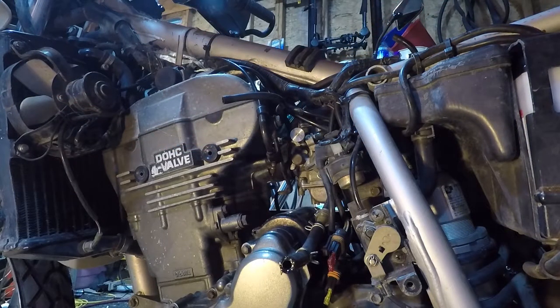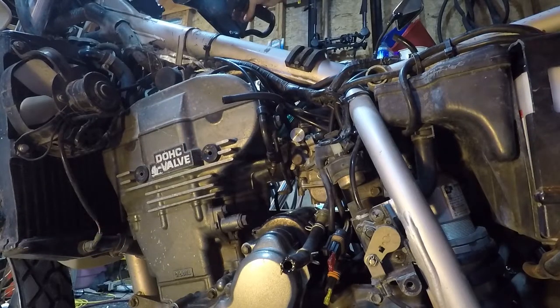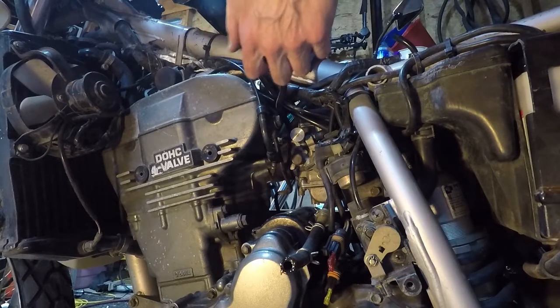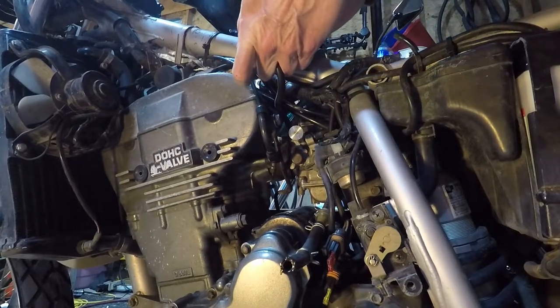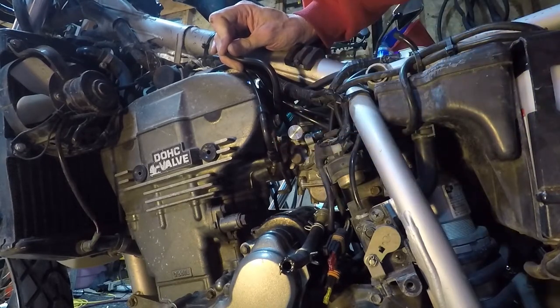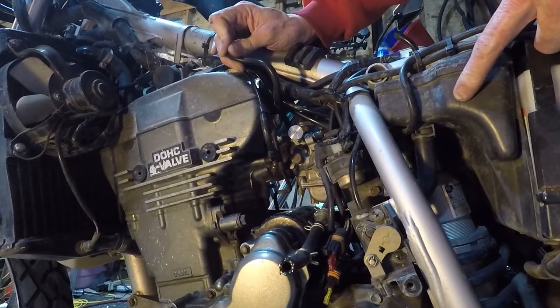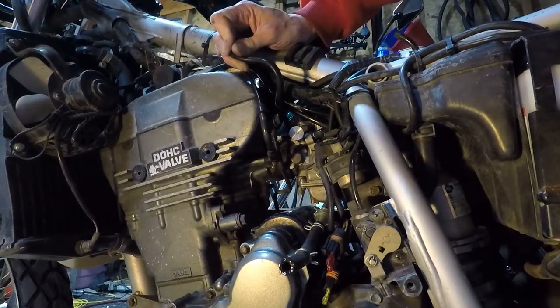Okay, first with the choke off — it may start, I've run it recently. No, it didn't catch. I should probably plug the vacuum hose to the petcock. We'll give it some choke and then I'll plug the petcock line. Here we go. It is kind of creeping back in on its own — I don't know if you can see that. I don't know if that's a feature or not. Let it run for a second and we'll see if we can get it to run off the choke. All right, that seems to do the job. I can strip it of the old assembly, the old cable and stuff — keep it simple.